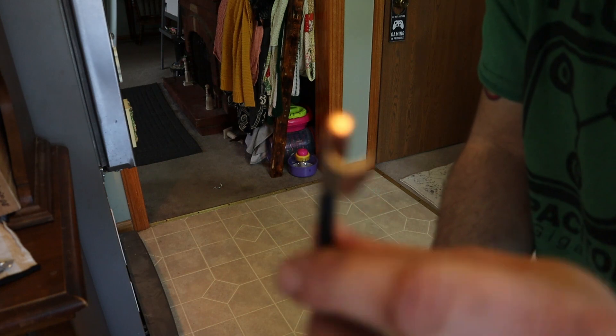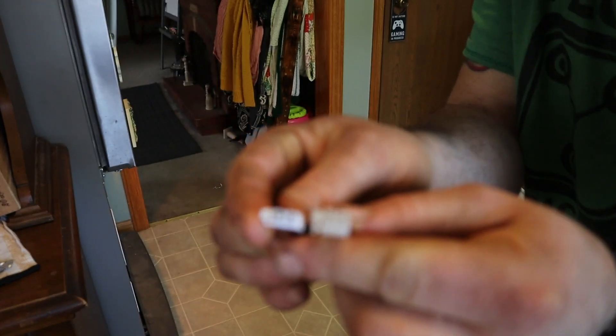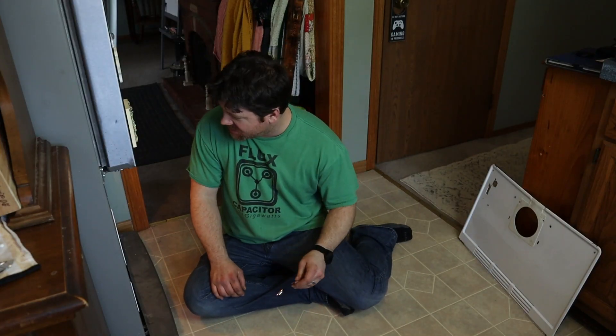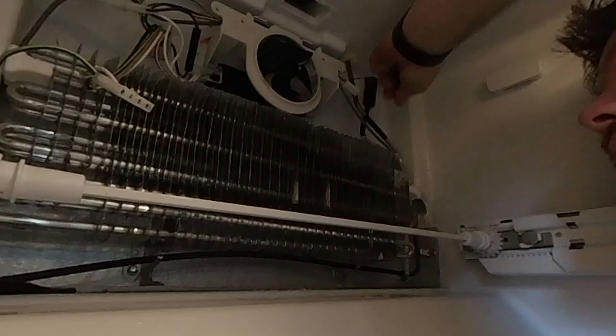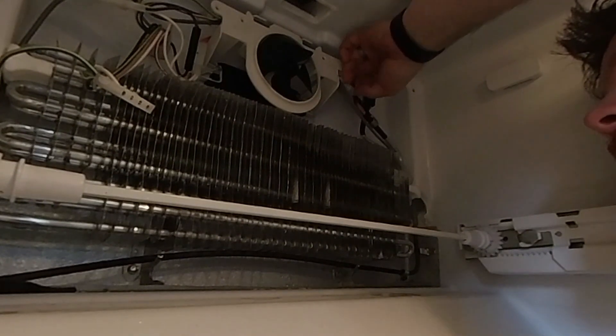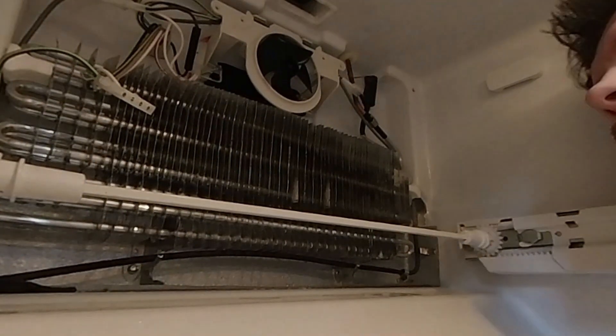This reading is indicating it's actually more like 100 degrees in the freezer from the research I've found, which means it's not turning the defroster on or it's turning it off too soon. Your new one should read around 2.1 to 2.7 kΩ. Here's a side-by-side comparison: the old one was aluminum foil taped on, and the new one simply clips on. Verify plug-in style — they are the same, so we're good to go. Climb into the abyss one more time with your new sensor and reverse of removal, except for the tape — just clip it on and plug it in.